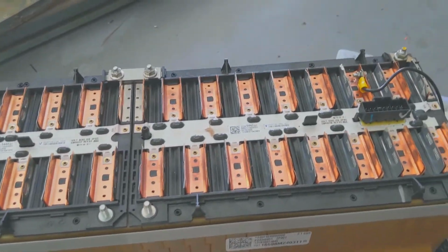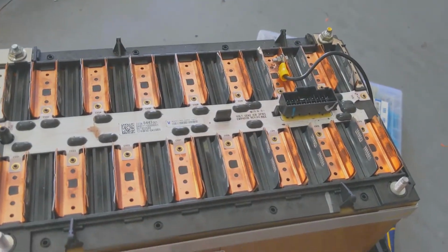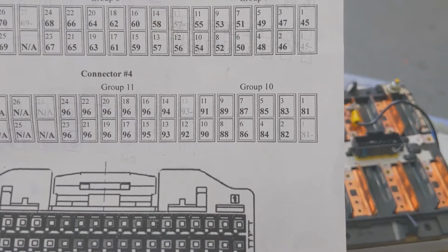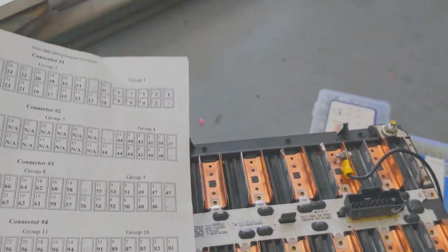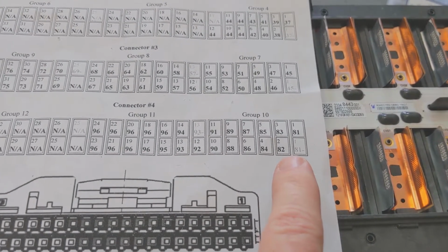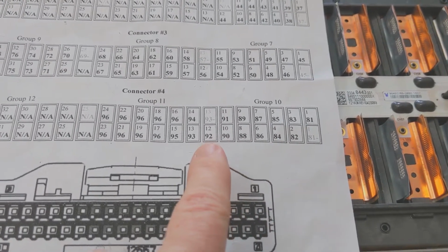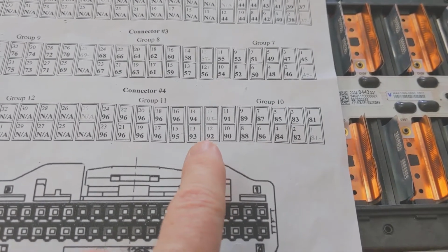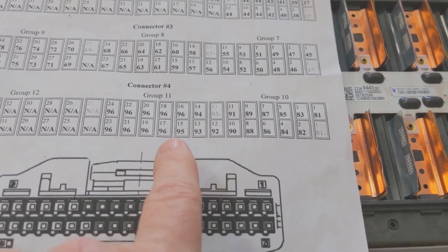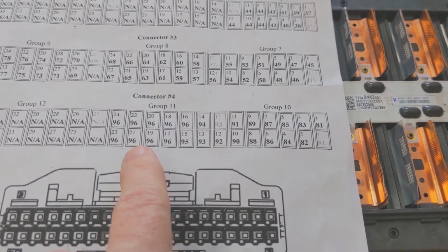But then something kind of strange happens here. So this is a row of 16, and this is what we're addressing here in the last connector group. If you notice, this last group, we're going to do a full set of 12, and then we're going to kind of start over, and we're going to use just the remaining 3 or 4 cells here in this group, and we tie them together as we just sort of talked about.